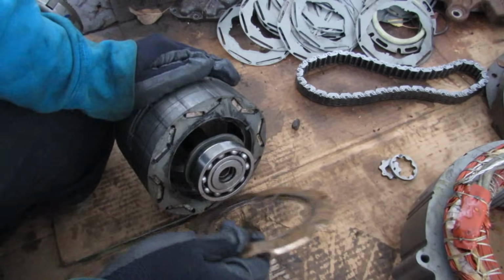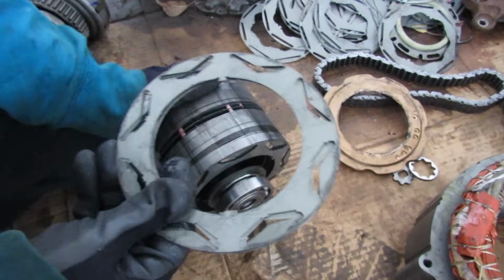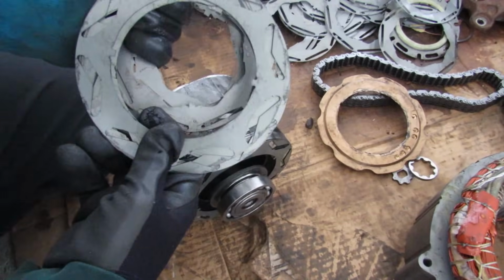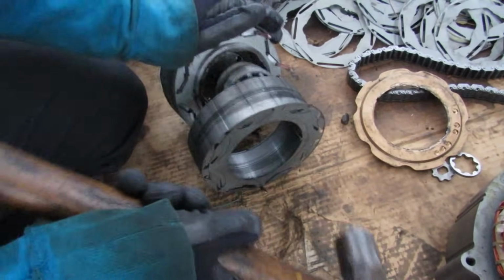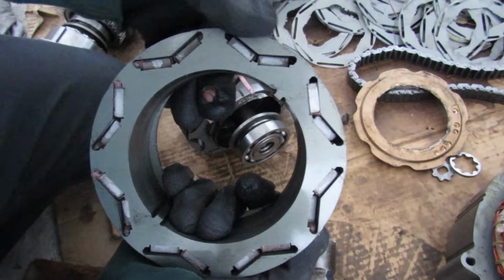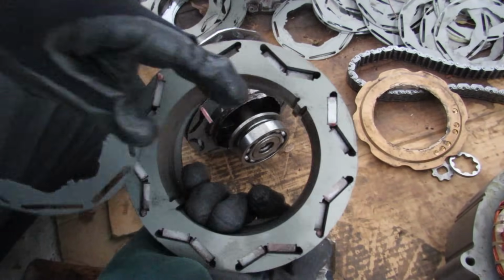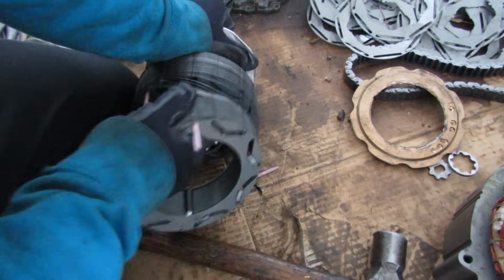Alright, so I've undone the lamination. I can take out this top plate here. Here are the plates here that form MG2. You can see how much larger these ones are. You can try to separate that. Looks like one set here. You can see the magnets here have a V shape, whereas on this one the magnets just have a slotted shape. So they actually use different magnets in MG2.